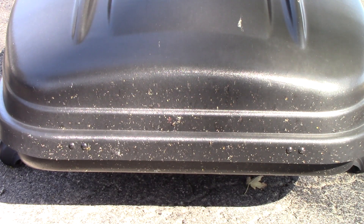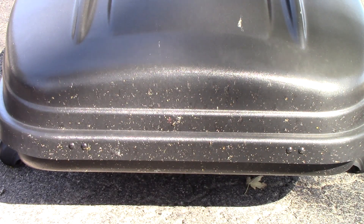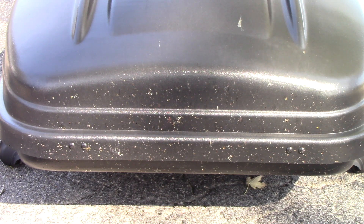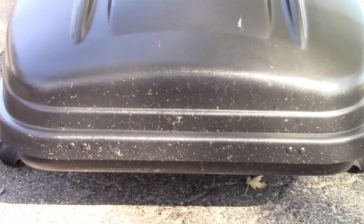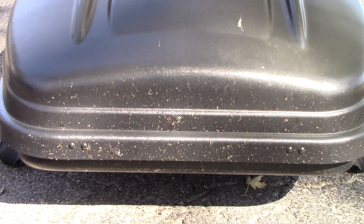We're gonna test Bug Release first on the plastic cargo carrier. It says to spread onto a cool surface, out of sun and out of wind — I'm hurting on both ends of that because I have sun on the car and it's windy. Allow it to flood the area and soak for 60 seconds, then wipe clean using a wet water-soaked microfiber cloth. Do not allow Bug Release to dry or evaporate on the surface — if drying occurs, simply reapply to activate.